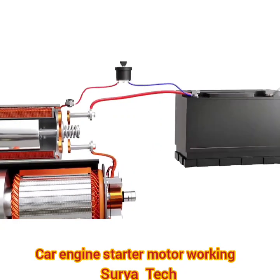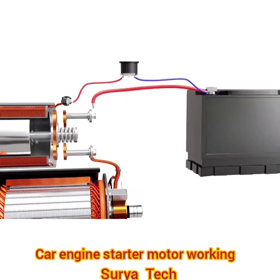We may wonder why the solenoid and the contactor are used instead of directly connecting the battery to the motor and reducing the complexity. The reason behind not using this circuit is the high current demand of the motor. The motor is considerably powerful and demands heavy current for operation. To handle this current, the ignition switch needs to be unusually large. It also requires very thick wires running from the battery to the switch and then to the motor, which is technically inconvenient. This is why a solenoid is used, which demands lower current for being energized.